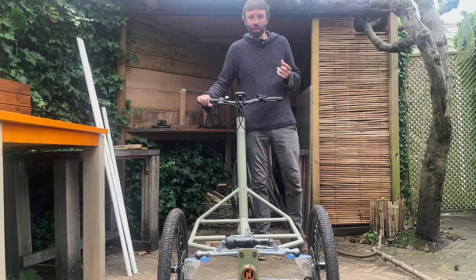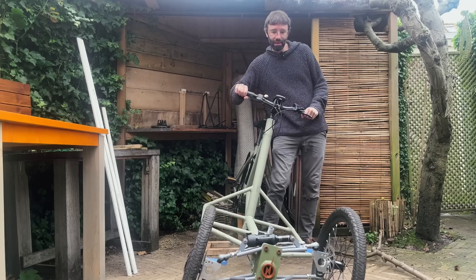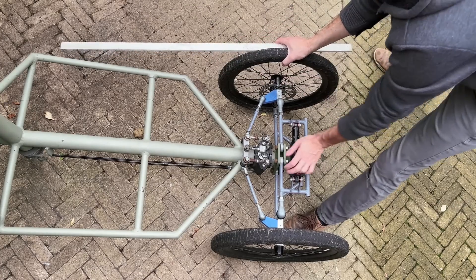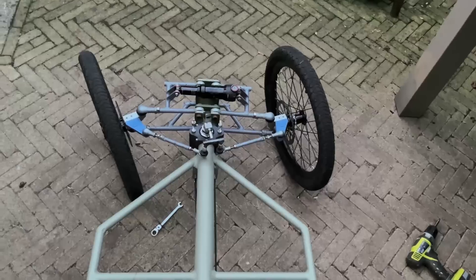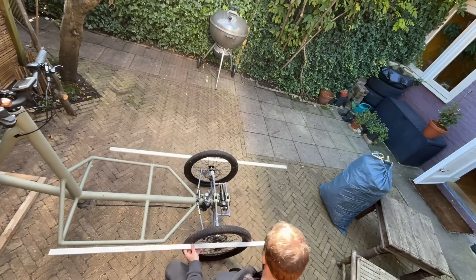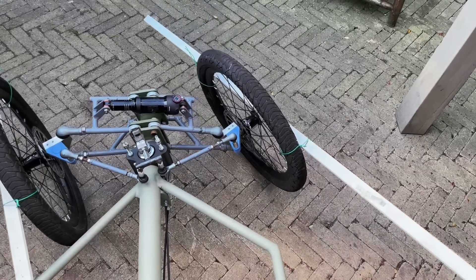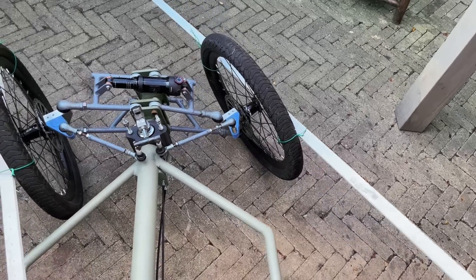Before starting the tests we have to figure out the steering — that is turning versus tilting. So a problem that became obvious was bump steer: when the suspension moves, the steering moves as well when you don't want it to. And I noticed too when I tilt, the outer wheel moves inwards more than desirable. And there you can see when it tilts, only the outer wheel moves and it does this unwanted motion — this is just super undesirable. This has to be fixed.